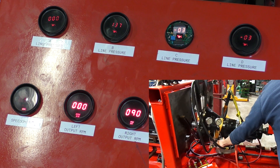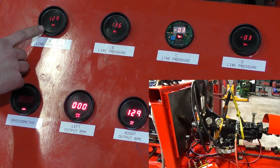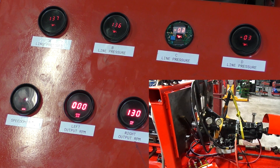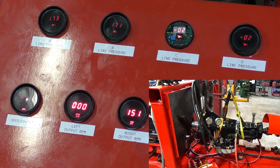Let's go to direct, or third gear. There's our third gear oil inside the transmission. Now let's hit lockup. We see an increase in output RPM when lockup is applied. We also see an increase in oil pressure. We know lockup is working in this gear.